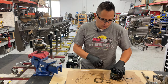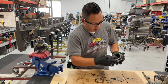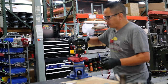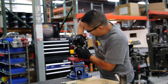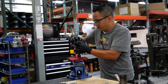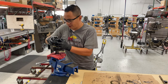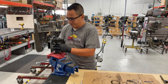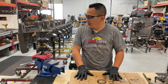When you get it brand new and put it back together, have some grease handy and spread it on the surface of the bearing, on this surface, and on the roller bearings. Then install the retaining ring — give it a little spin and it'll come down faster and easier. Install the keepers — push upward a little bit and they engage. And that's it; you have your clutch back together. Thanks for watching, and I'll see you guys next time.